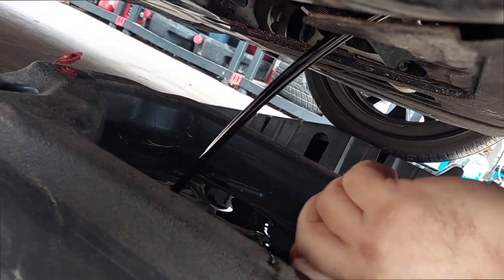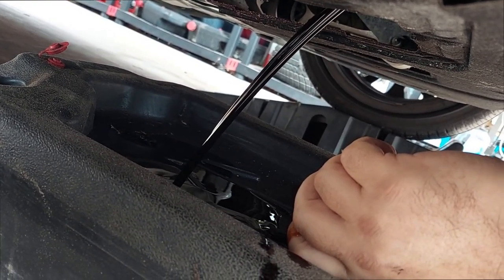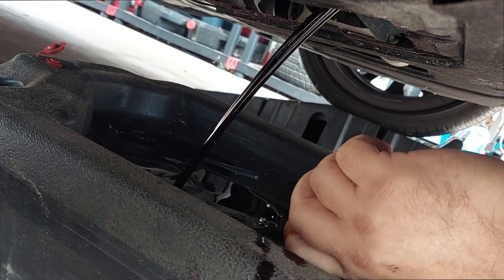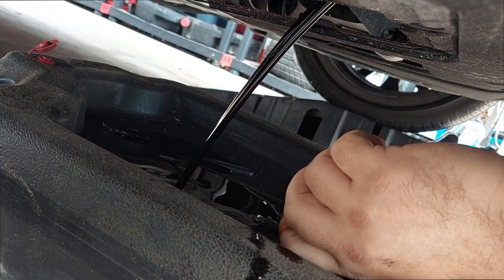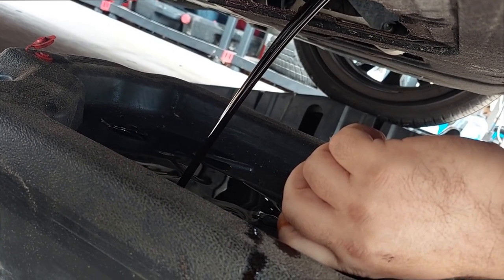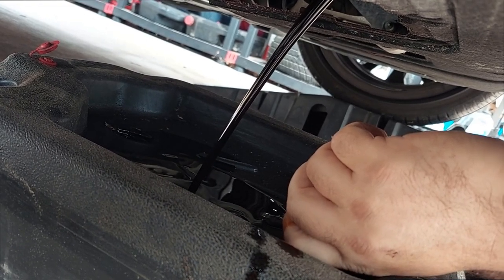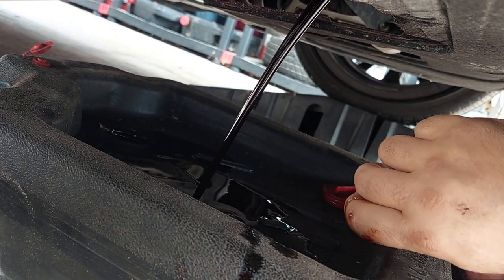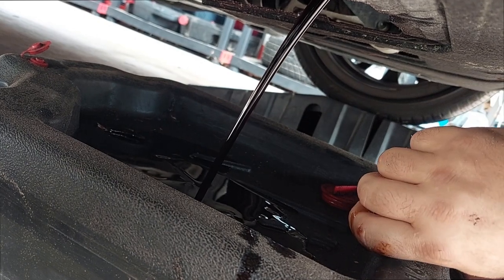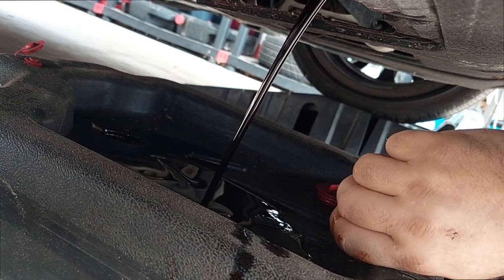Good and dark — about 6,000 miles on this oil. This vehicle, you have to stay on top of the oil changes because it is direct injected, and you get fuel contaminating the oil. If you run too long, you end up with thin oil. Unless the engine is designed to run thin oil, that's not a good thing. And this being a pretty hot turbo, they want at least a 30-weight in it. So if fuel dilutes it down to a 20-weight, well, you're out of warranty, aren't you?